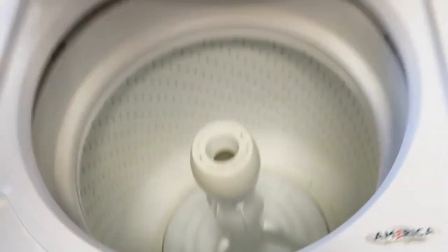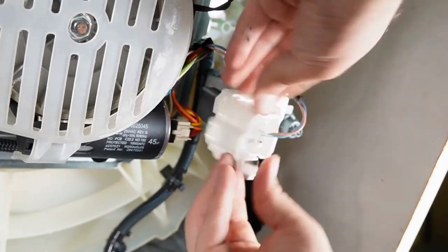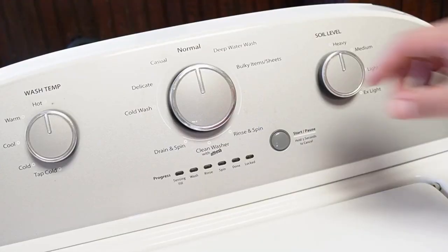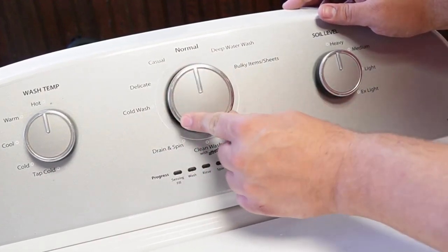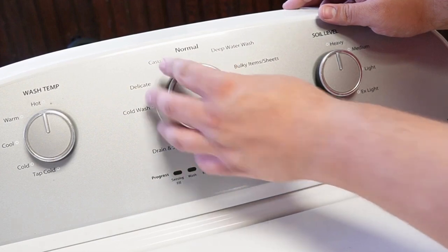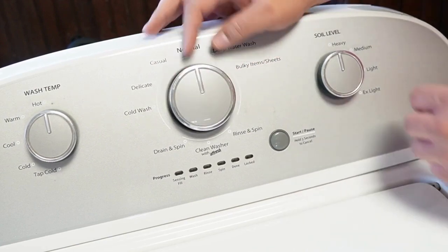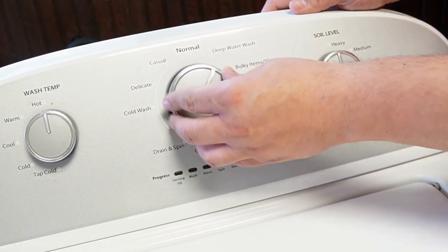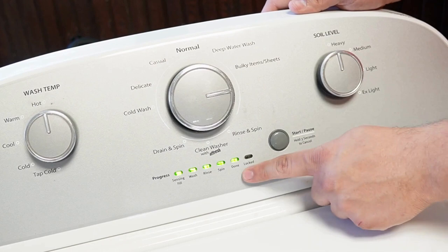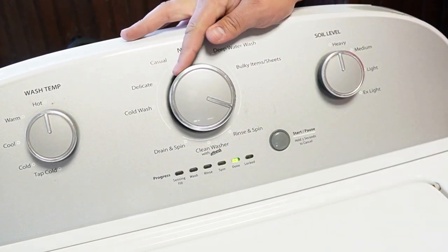Now let's go ahead and attempt to recalibrate this washing machine through the calibration mode. This is a must-do if you've installed any new parts on the washing machine, from a board to a balancing rod. With the washing machine freshly rebooted, rotate the dial counterclockwise 360 degrees. Then turn the knob right three clicks, left once, then right once again. You need to do all these things within three seconds, and it may take a few attempts, but if done right, all the lights at the bottom of the washing machine control should flash on and off, showing that you've entered diagnostic mode.